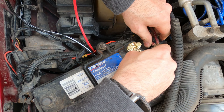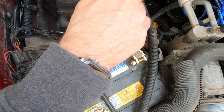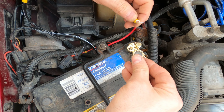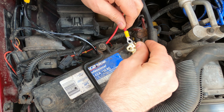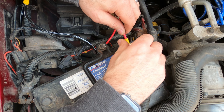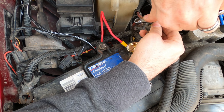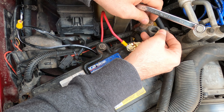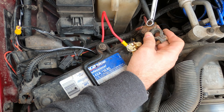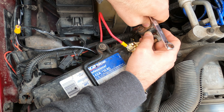I'll keep going with the one on the positive since that one's already been cut. I'll leave those wires out for the auxiliary lights — I won't remove them just yet. I just want to make sure that at least my routing for all my cables that are going to be used is appropriate. Depending on how bad these are I may have to put it back on the battery to have a little bit of torque — in this case they're being reasonable. Hopefully whenever these were installed they took off the right amount of wire for it to sit correctly under the clamp.